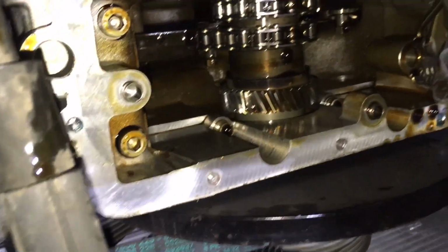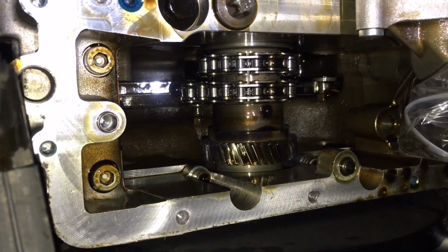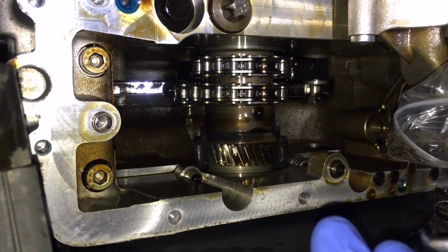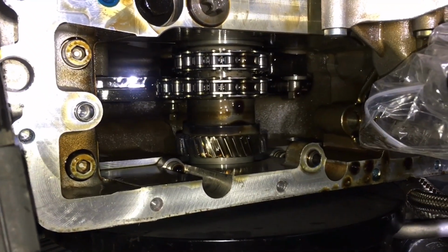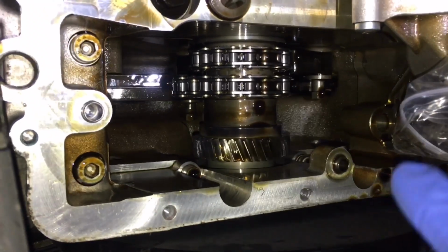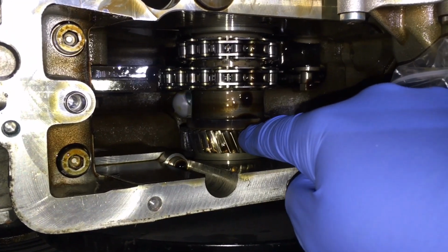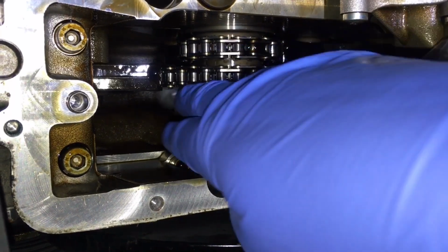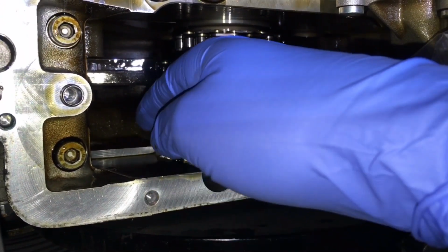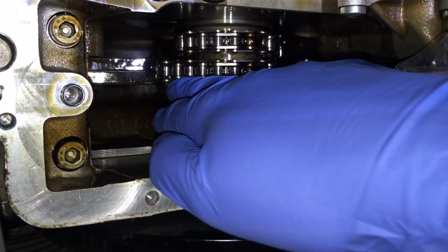So I'm now under the car, and we're just getting ready to send the Vanos high pressure pipe through the engine block. So it's just going to be coming down now, and I'm going to try and guide that into position. We've already got the Vanos high pressure pump removed to give better access, and whilst that's coming down, we can just talk about this bolt-on helical gear wheel, which is the drive for the Vanos high pressure pump, and that one I'm just trying to help ease the high pressure pipe coming down.